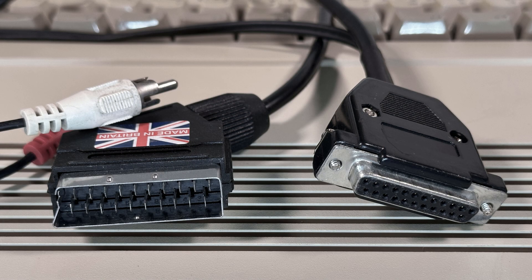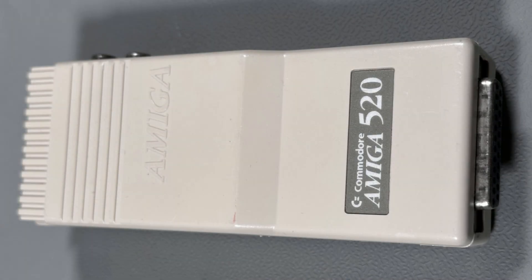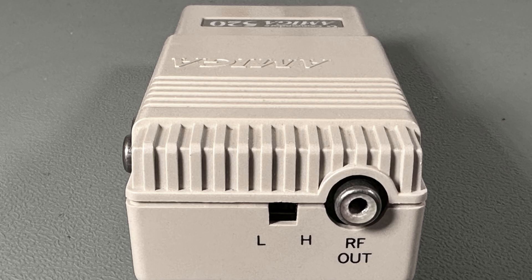If you were lucky enough to be in Europe and you had a TV that supported the SCART connector, then you could use one of these RGB to SCART adapters that would give you a fantastic picture, assuming your TV would take RGB input. My Philips monitor that I use here also has a SCART connector on the back of it. But when I was younger, I didn't have a monitor or a TV that could even connect via SCART, so I had to use the A520 — no, that's not a road down south somewhere. The A520 takes the RGB signal and converts it into two different formats, one being colour composite video. But sadly my TV didn't have a connection for this, and so I was left with the lowest quality option: connecting the Amiga via the RF signal directly into the antenna connection on the back of the TV. And this is how I used my Amiga for pretty much all of the 90s.